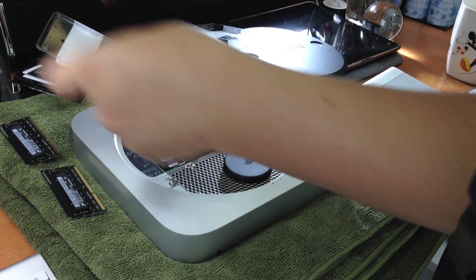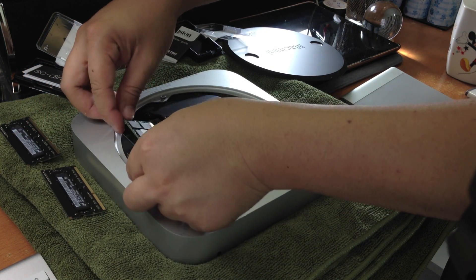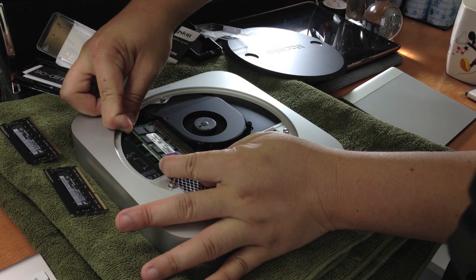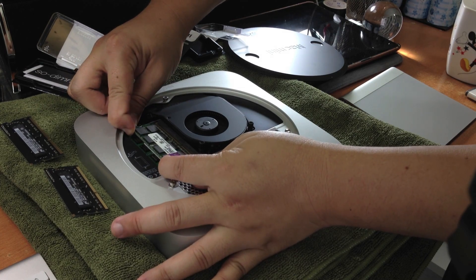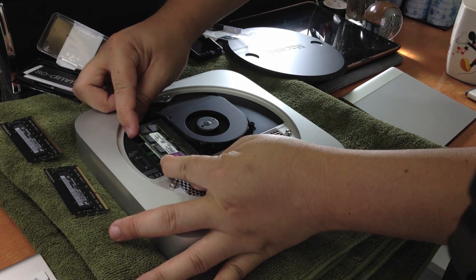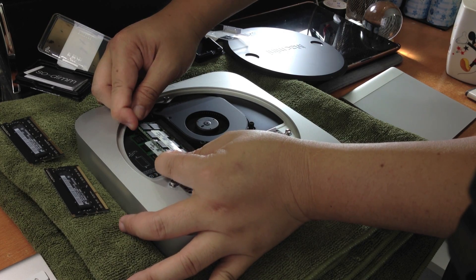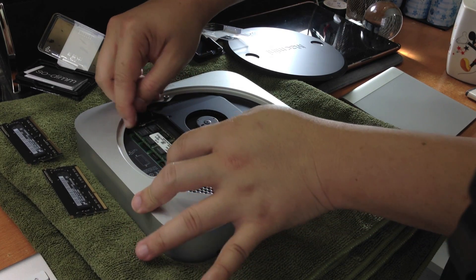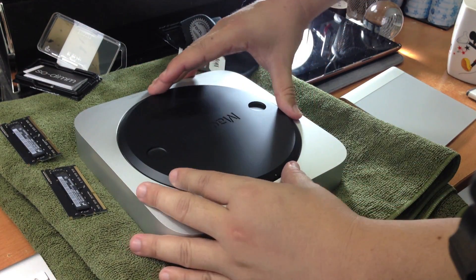Repeat with the second RAM in the top slot. I believe this is the simplest RAM installation I've ever done — previous Mac Mini models were not so simple. Push it down at the correct angle. Do not force it too low — I actually made a mistake here, so do not do what I'm doing. Once I pushed it slightly inverted it bounced back up, which is the correct angle. The correct angle is slightly higher up, which will not damage the connector. Once it's placed in properly, press it down gently and you'll hear the satisfying click.